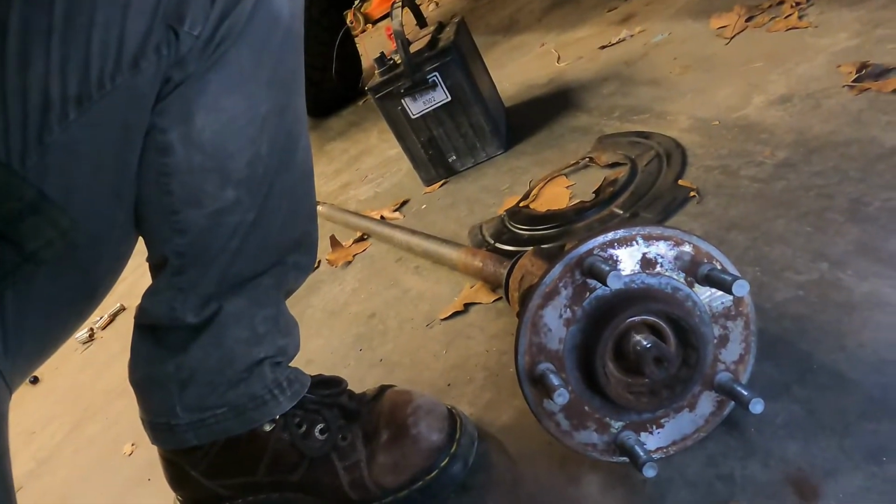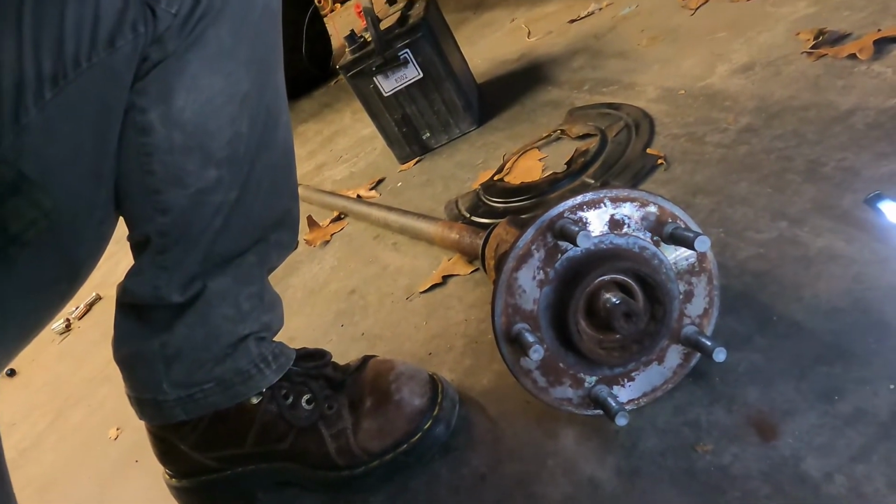This is actually a 3/4 socket with an adapter to a 1/2 inch. So I am fortunate enough that I have a Milwaukee Impact that takes everything off of everything. So always nice to have the right tools for the job. So all right, that said, axle shaft, wheel bearing, I'm going to separate those two. It's just banging on a hammer a couple times, but we should get that done, and I will have the passenger side done. And then I'll do the same thing to the driver's side. Hopefully nothing comes apart this time, and keep moving forward. Then we'll move on to the differential.